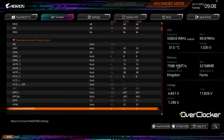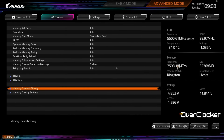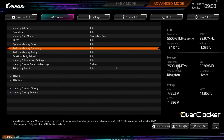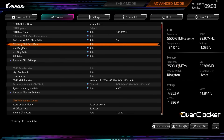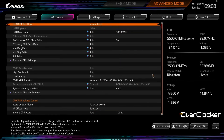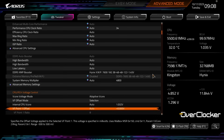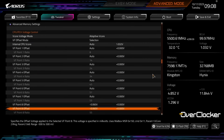It's fast, it's high resolution, full HD, the mouse is smooth — safe for a few select areas — and it has plenty of new features that help extract performance from the CPU and memory. For example, the CPU optimization menu comes to mind. This is where you can select from Spec Enhance, Unleash, Instant 6GHz, and a few other options, each one tuning the CPU accordingly — either focusing on lowering temperatures and power draw, increasing performance, or a balance of the two. I ended up using a combination of these options along with my own offset voltages for the P-cores.